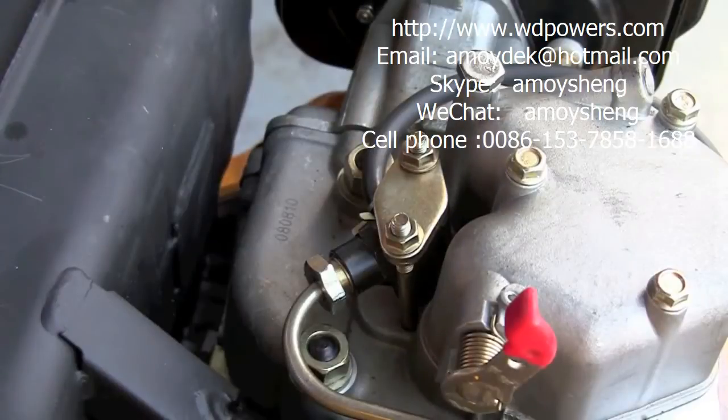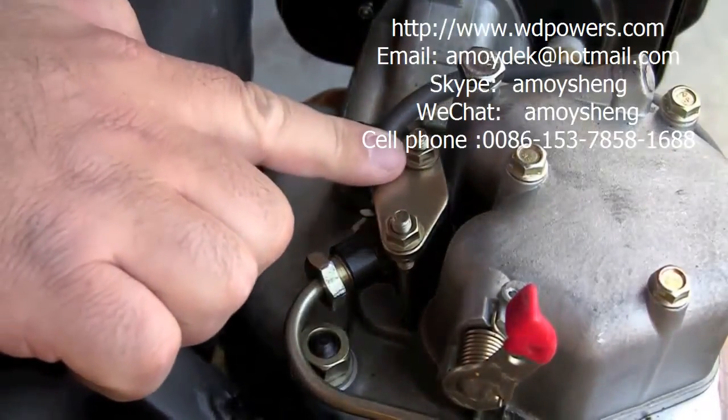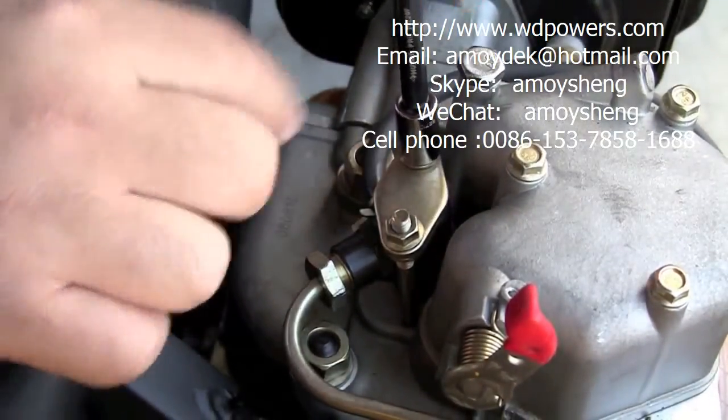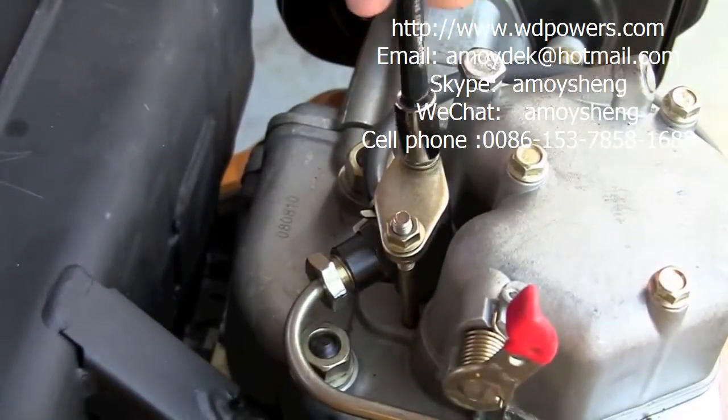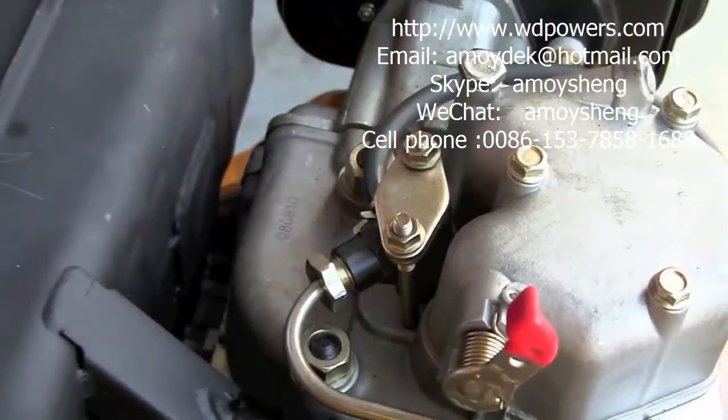In this video I've done this in the reverse order. I'd recommend not removing the two bolts first like I've done here. I would first want to loosen the high-pressure fuel line right below it — it would make life a lot easier.